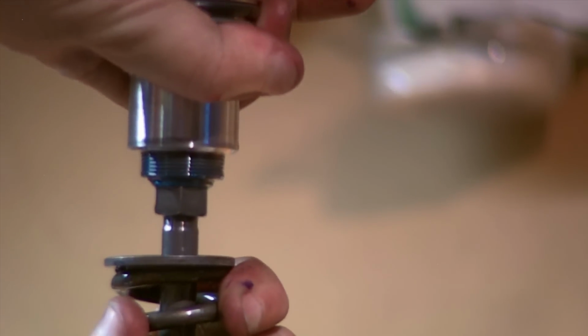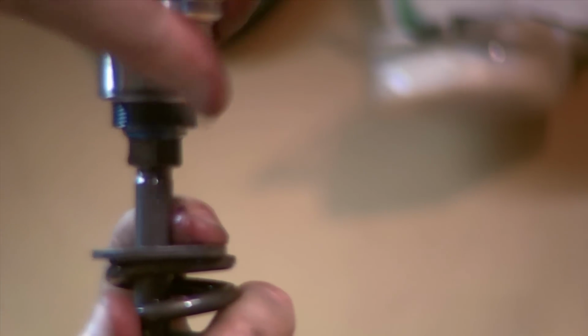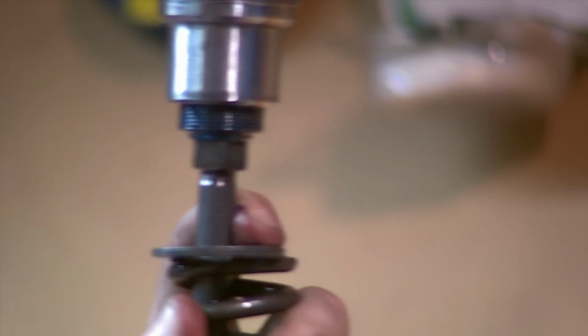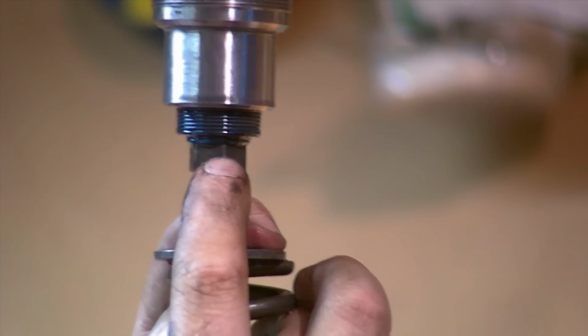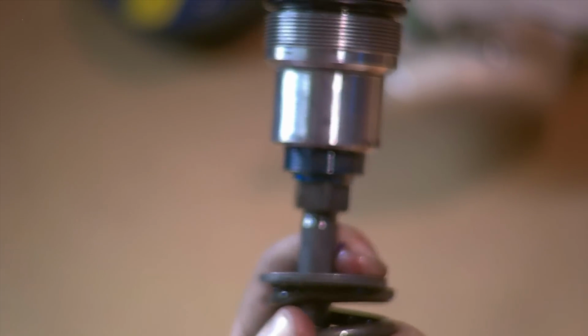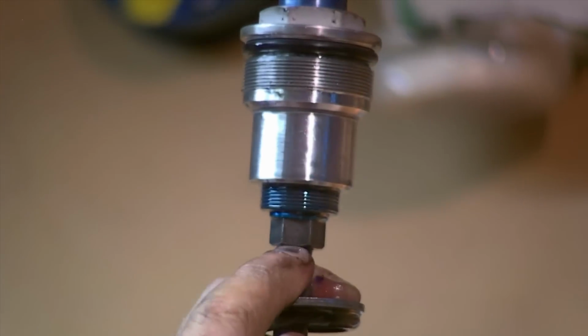Cap here, you can pull up on the rod assembly. There is a washer. Remember orientation of your parts before you take things off. But there is a nut. It's a jam nut. It's locking the top cap here to the damper rod, the inner rod where this nut is. So we need to hold this in place using the flats up here from that 27 mil, and then crack this nut loose. The position of this matters.